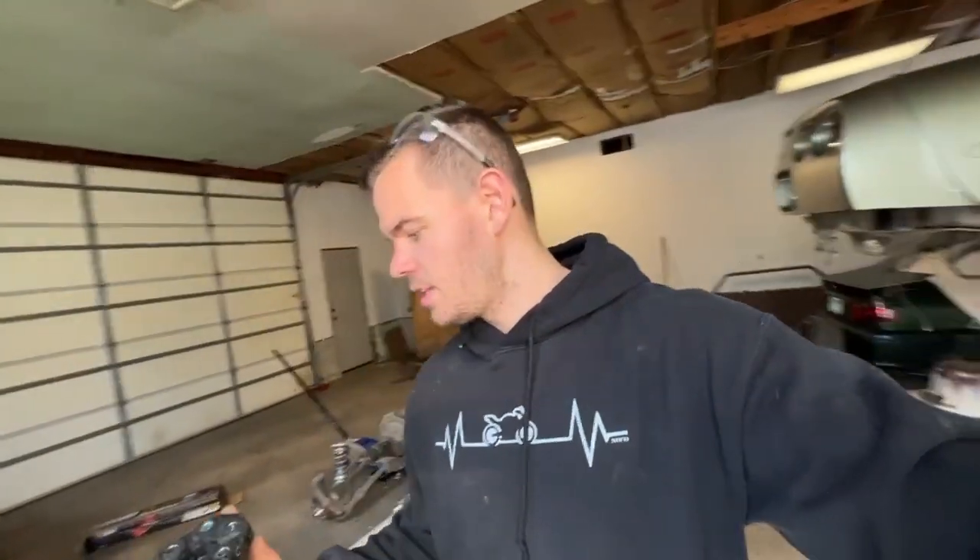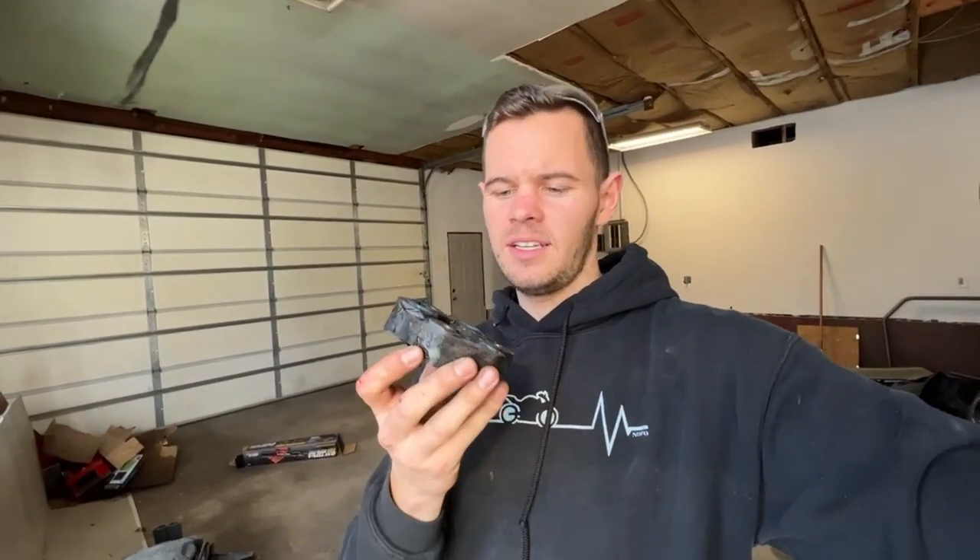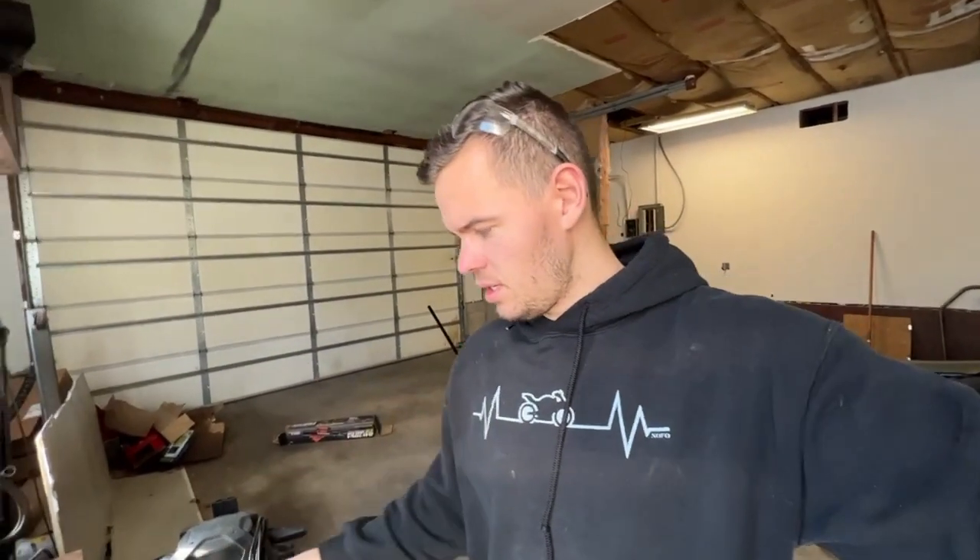Just a quick check-in. Got the input shaft off from the drive shaft — input shaft to the engine. Got the guibo off, the coupler, whatever you want to call it. It's a little rough. I'm not sure how much longer it would have lasted — if you can see, it's cracked all around it. I got that off. The bolts were pretty tight, they're loctited in, but they weren't too bad.